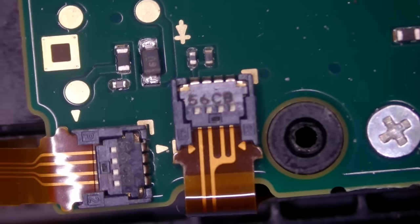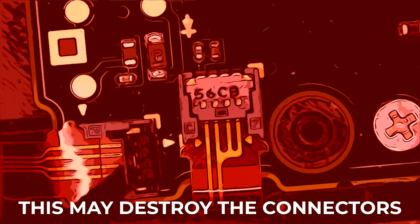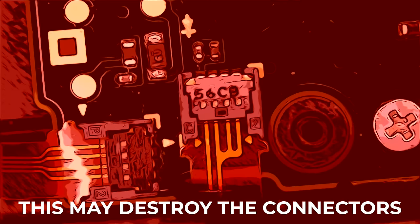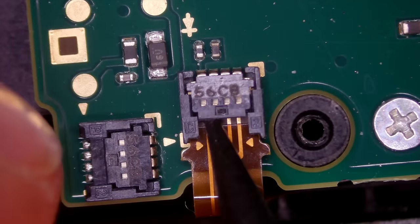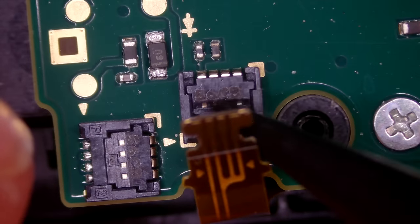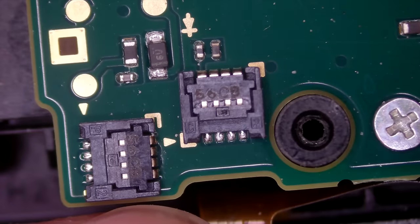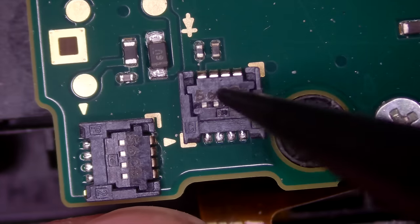Let me have a quick glance at how to disconnect those connectors. In retrospect, I would not recommend bending those connectors upwards for ribbon cable removal. I think those are designed to have a slight springiness to guarantee a good connection. So just try to remove them without any bending at all. That's a strange connector - there's no locking mechanism. It's just holding down with the metal connections here.